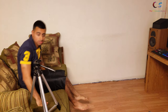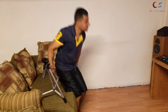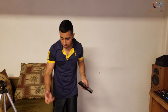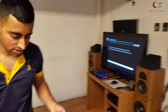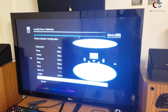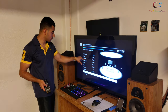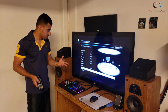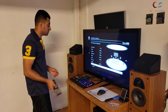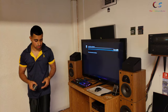If I were to sit down on the sofa, my ears are about right here, and you want this microphone to be around where you would sit. We're going to press this and we're going to start hearing the test sounds — I'll move out of the way so the microphone gets everything. Everything's done; it put the crossover frequencies by itself. I'm going to go back and change these a bit because I want my front to be at 80 hertz, not 40, so the subwoofer does more work. We're going to save this and see how it sounds now, then unplug the microphone.